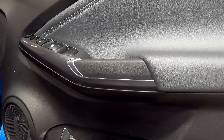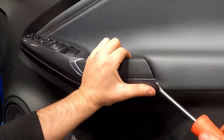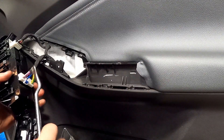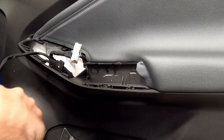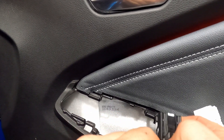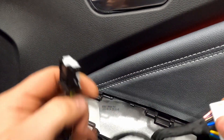First off we're going to remove the door handle cover, this little bit here. Just come out the corner and sort of lift it. You need to unplug all the wiring off the back of it. These have got little push pin bits, so you just get your screwdriver or your trim tool to push it in and then just pull them down and they'll pop out.